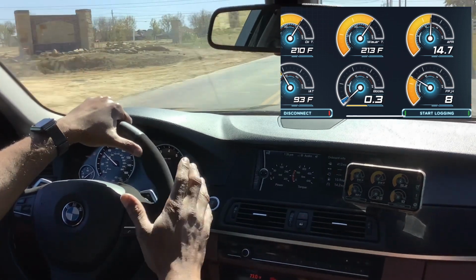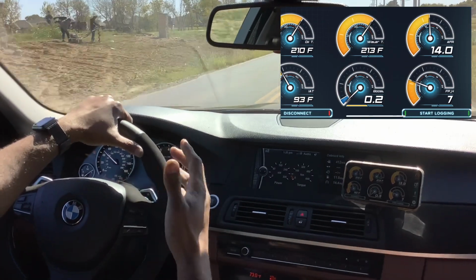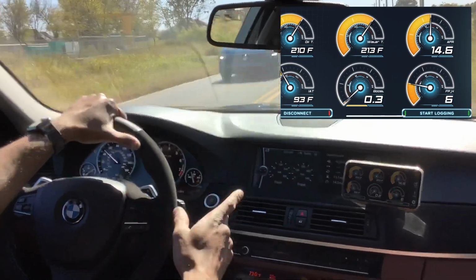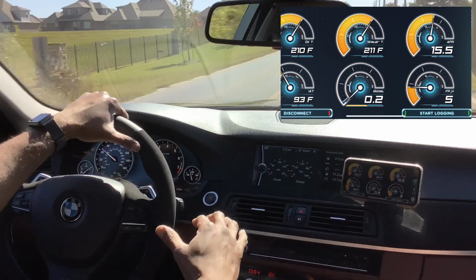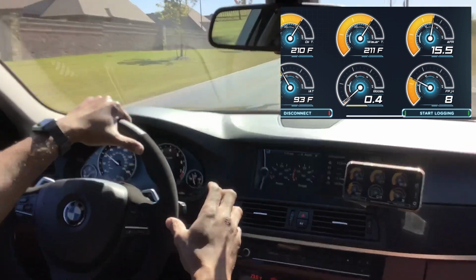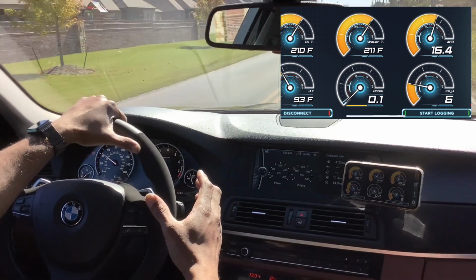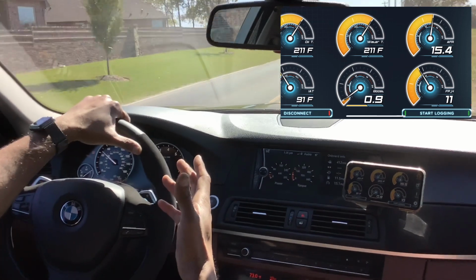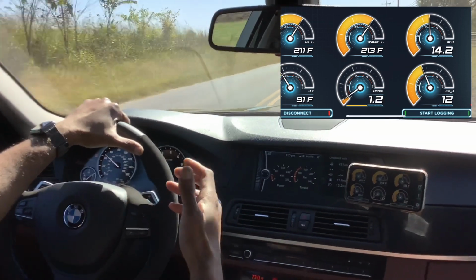Again, normal boost pressure, for me stock, I could kind of cap out around maybe 9 or 10 psi. Running the JB4 on map 5, especially with ethanol, I can get all the way up to 18 pounds of boost. Does it make your car a rocket? No. Does it make it pull a lot harder? It certainly does. To me, especially if I have the car in Sport or Sport Plus, Sport Plus is typically what you want if you're logging or anything like that.